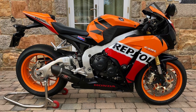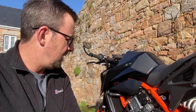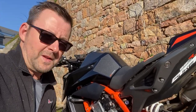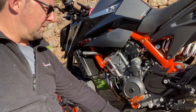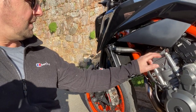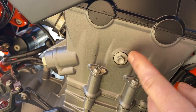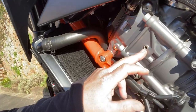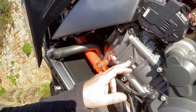Just take a moment to have a look around the bike to make sure you've got no leaks. Historically, the first-gen 890Rs and the 790s have had a couple of issues — the front sprocket seal was a known problem. Always good to check under the bike if it's been parked overnight. There were some reported leaks on the top of the engine block seals, and the thermostat area can also be an issue, but on my 2021 model I've had no leaks whatsoever. That small hole there is just a water drain hole.